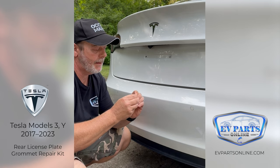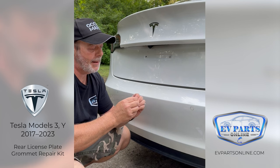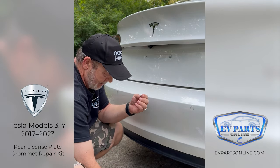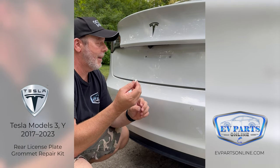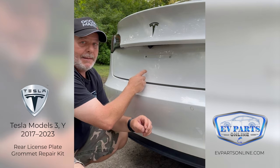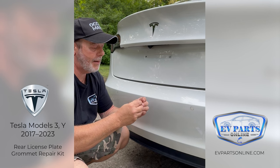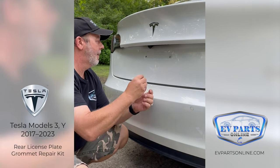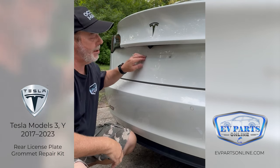We're going to do the same thing on this other one. This o-ring looks pretty good so we're going to reuse it. If the o-rings are missing or bad, it's not really that important. We give you four grommets in the kit, so if you're only using two, just use two. If you've got other holes, just use the remaining grommets and replace them all. Line it up, give it a push — you can see these push in a lot harder.